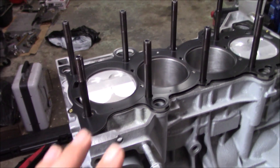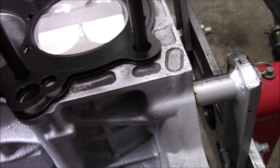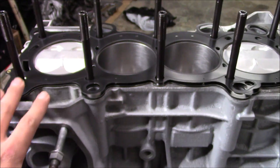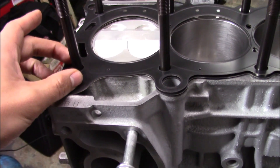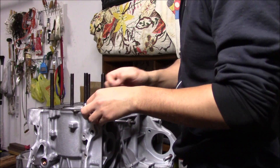Although I showed where the dowel pins go on the head, I'm actually going to put them on the block side instead. The reason: as you can see, this head gasket moves around. To locate it better and so the dowel pins don't scratch the top of the gasket, I'm going to put them right in the spots where they should go — you can see the little radius on those holes on the intake side. This way the head gasket is basically centered and when the head comes down it doesn't get crushed in the wrong way. Just slide the dowel pins right down and line them up.